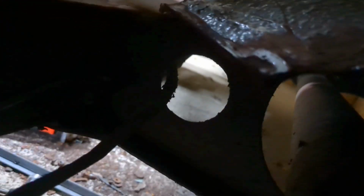I'm keen to unbolt this. I don't really know what these bolts are doing, so I'm going to have a little explore on that, but the main objective today is to take out the brake pipe. Oh, there's a union, yes, there, that's really easy. So brake pipe and cable, wiring loom should I say, so that I can start to have a bit of a grind around and a clean up around there to find out exactly what we've got going on. So the job will be just to remove that union and have a tidy up.